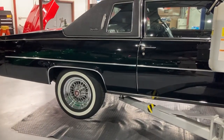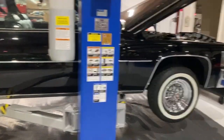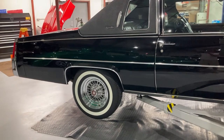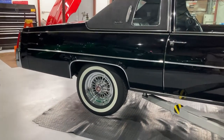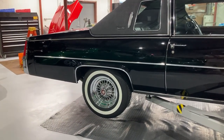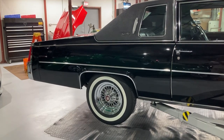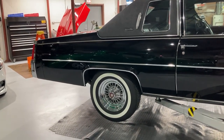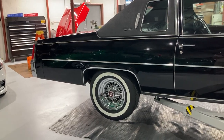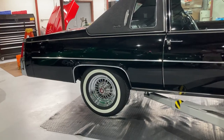One of the downsides to most of these Cadillacs is the rear gear ratio. Most of them are 2.29, and this one's no exception. One of the things we're going to do to this car is put a 2.73 rear end ratio in there with a posi-traction carrier. Cadillac uses something similar to the corporate 8.5 rear end but it's its own animal — it's an 8.8 rear end found in larger cars from around 1977 and even earlier, like some mid-size station wagons such as Malibu wagons.